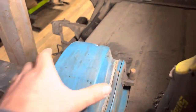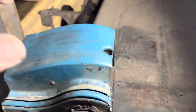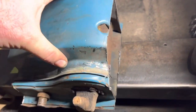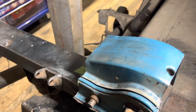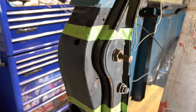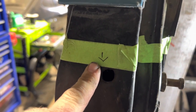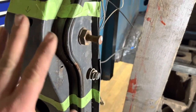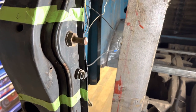Fast forward - I've removed the best bit of that rear goalpost from the damaged side. It had a little bit of a bend in it, but I've straightened that out now. I'm pretty happy with that. I've taken quite a lot of time measuring it, finding various reference points on that panel that match the later goalposts, and I've got it all marked out. Always remember before you cut, always mark the line you're going to cut - I was very close to cutting the wrong line, which would have been a bit of a disaster. Obviously measure everything as well.